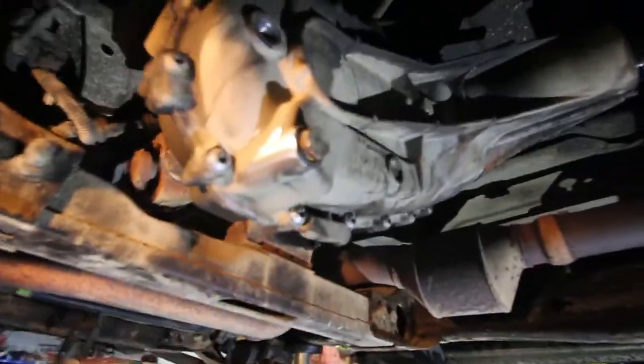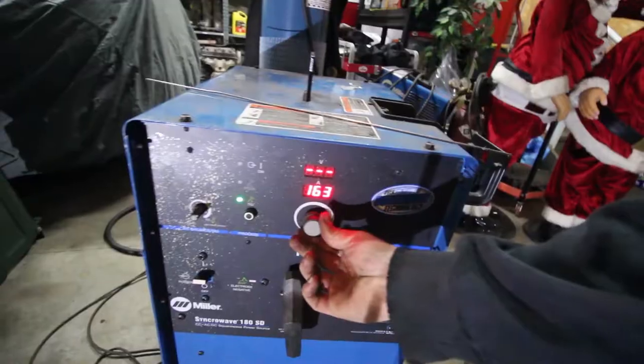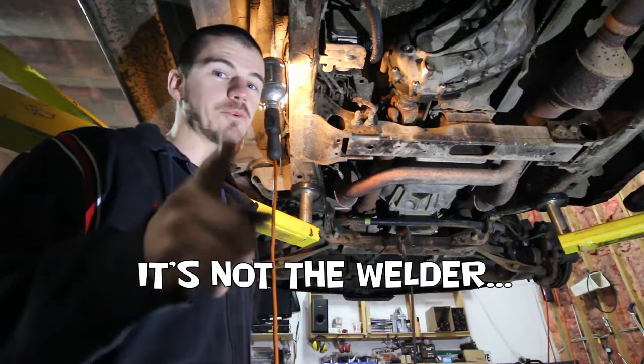I'm about to start welding. I grabbed a grinder and polished it up a little bit - you can see the crack there. I brought my welder out. I'm not the best aluminum welder but I'm gonna give it a shot. I've disconnected the negative battery terminal from the truck - this welder runs on high frequency for aluminum welding and I didn't want to mess with any electronics, figured it might do some back-feeding or something strange. Just to save any hassle, I undid it.